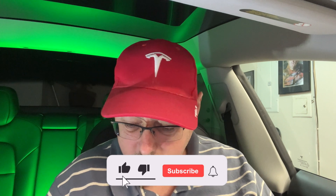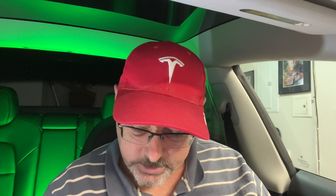I'm going to rerun that test - I said I'd run it every year while I have the car. We're going to go back into service mode and run that test. Right now I'm at 41,000 kilometers, 25,000 miles, and currently at 8% charge. I drove my car back and forth on the highway. I preconditioned the battery as if going to a supercharger, so it's pretty hot - maximum temperature is 45 degrees Celsius, minimum is 35 degrees Celsius, and charger temperature is 41 degrees. Nice and toasty.